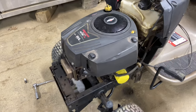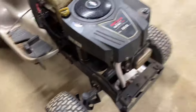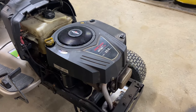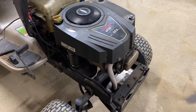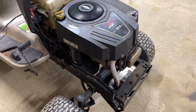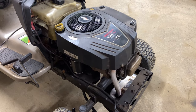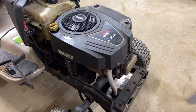From square one to right now, this one was not that difficult, but it was a bit of a process to figure out. You have to go through the steps to diagnose it: check the oil, check the fuel, check the battery. This one did crank over, so it was really a crank-but-no-start condition. This one was fairly easy — it was just a spark plug.